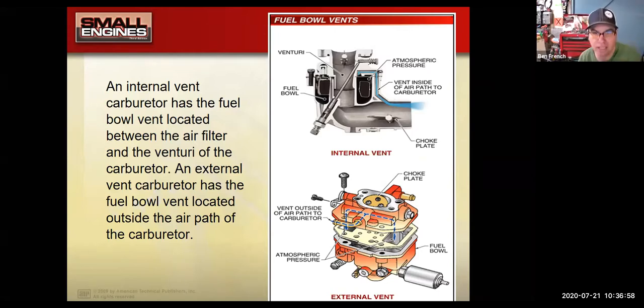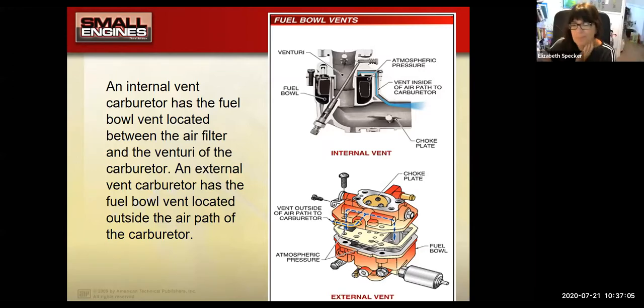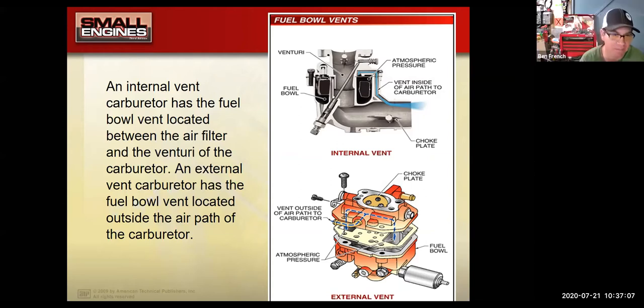So you usually see those solenoids used on like a riding lawnmower. So it's got a battery on it. Okay. I have a generator here and it's got one of those solenoids, but again, it's going to produce electricity as it's running. It's got electric start. So you tend not to see those solenoids on engines that don't have batteries. But if an engine has a battery, it's likely to have one of those anti-afterfire solenoids. So you don't see it on the really inexpensive stuff, but on the newer, more expensive engines, you see those solenoids. So again, here we have a shot where we can see it's got one of those solenoids.